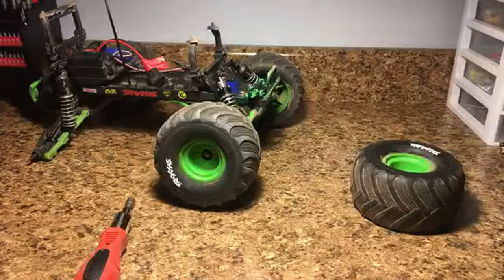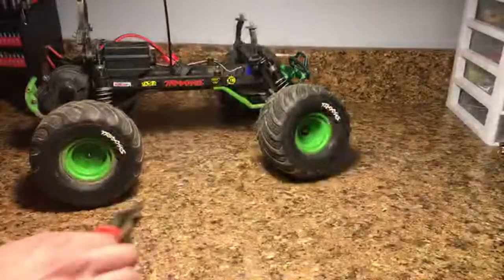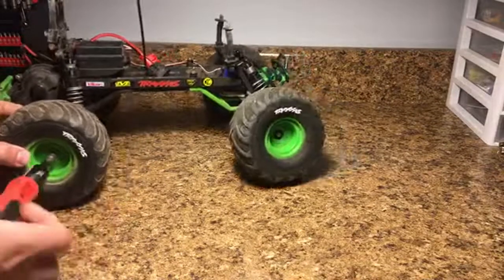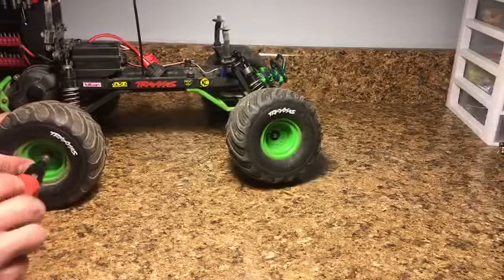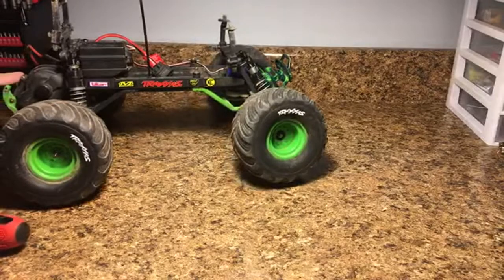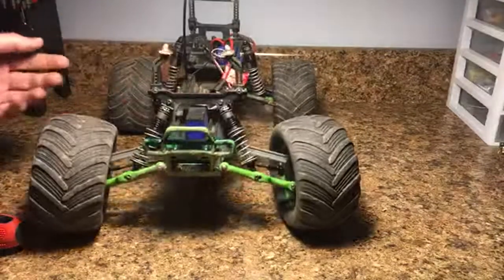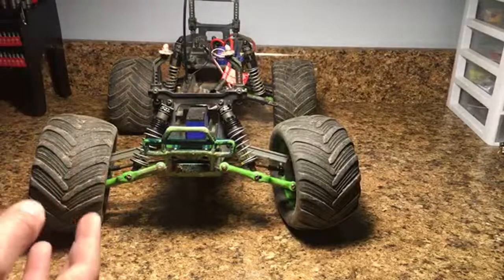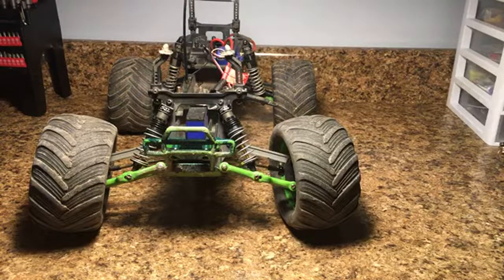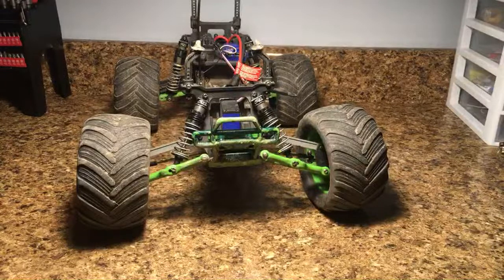My shocks were getting stuck down — was it a wise idea to spray them with WD-40? If it worked, then that's fine. I am a user of WD-40. A lot of people say it's not good for lubing or oiling up a truck — it depends on what you use it for. I would not recommend putting WD-40 in a transmission, but on a shock or on an axle joint, I think that it's fine. The only downside to putting WD-40 on a shock is it's going to attract some dirt, so if you're running through a lot of dirt or dust or sand, it's most likely going to get caught up in there. But other than that, if it worked, it's a good choice.